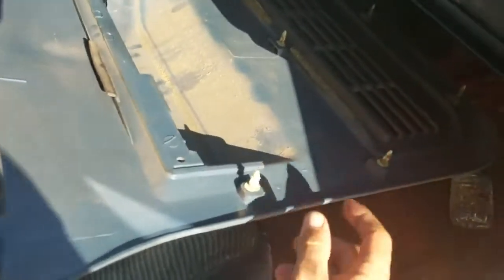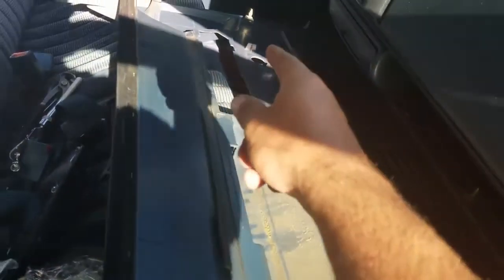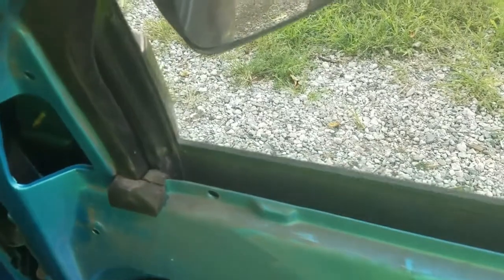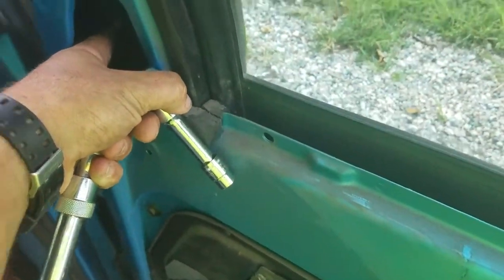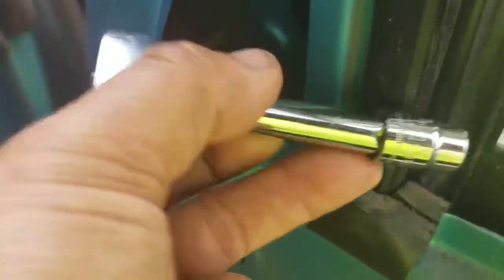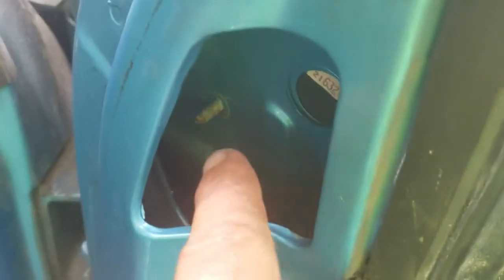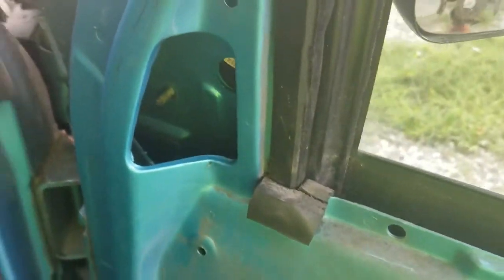In the back of the door there are a bunch of little clips all the way around. Slowly pull off on the corners and work your way around. Then you need to take off these bolts — this is where a 10 millimeter comes in handy so you can get it inside there. A flex head without the extension and just the 10 millimeter fits in there nicely. You can also use a 10 millimeter wrench, but a ratchet made it a lot easier. Take these bolts out and we'll move on to the mirror.